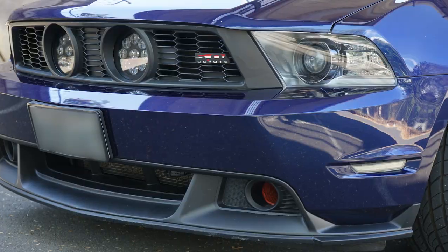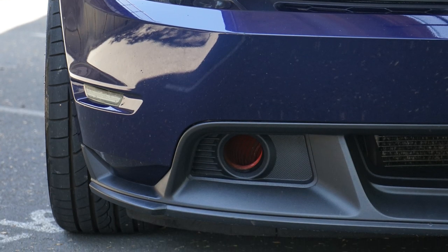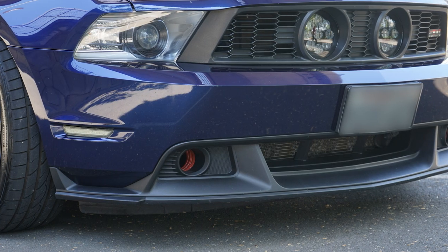Let's start up front because some of my favorite mods are up there. Let's start off with that Voss front fascia. I really like that myself, so that's why I got it. It's pretty cool, especially the little extra attachments you could put on it, like the brake ducting system or the fog lights, whichever one you choose. You ended up doing the brake ducts — you take that thing out on the track? I'm really just on the street with it, but the brake ducting system definitely works. The brakes stay way cooler. I had to take the front bumper off and trim the inside fender well just a little bit. It was pretty straightforward.